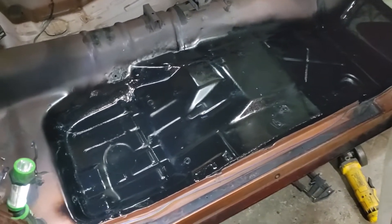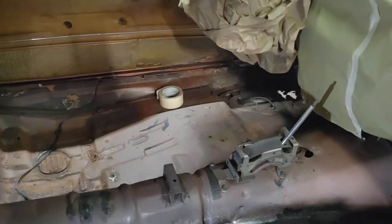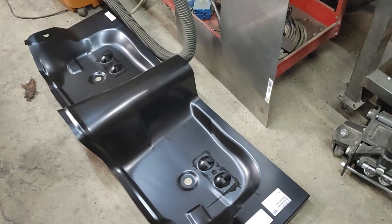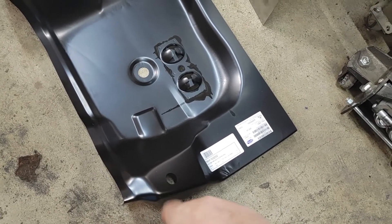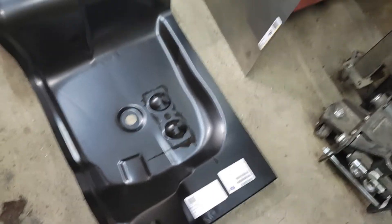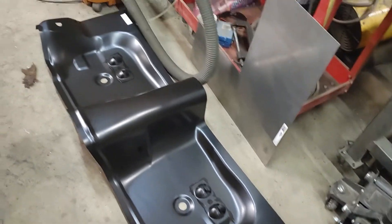We got the floor pan welded down. I grinded it — not perfectly smooth, but smooth enough — then painted it. It's done. Came out really nice. I got this side done; I still got to get that side done, as you can see the hole. The back end pieces came in today so I can get that taken care of. Right there where those little holes are is supposed to be the seat belt bolts — that completely rusted out, so I've got to take care of that. That's our next thing after we get done with the driver's side floor pan. Start that tomorrow and get it done.